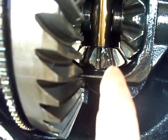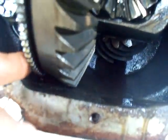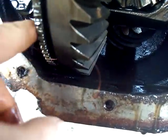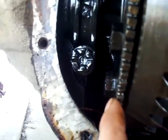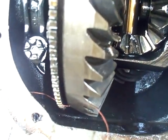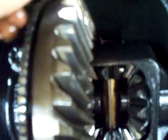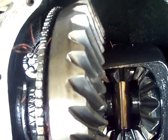My ABS light has been on for a long time but I didn't really care. With broken off spider teeth, I can surmise that the broken off teeth ended up down here where this exciter ring runs pretty close to the bottom. I can see some damaged teeth on this exciter ring, and I really think the spider teeth got broke off, ended up getting caught in the exciter ring, and ripped the end of the Hall effect ABS sensor off — now I've got coil wire all up in here.